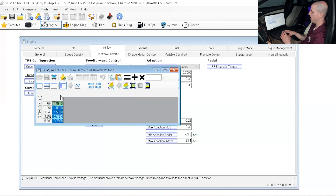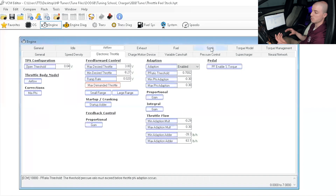What I like to do is go ahead and simply max that out. So we're going to put the number 3.8 in there, and that's going to say that as a driver, I can now add as much throttle as I want. Now there are multiple different ways we could get to this — this is just a mild way to do it. So we pop that in and now we move on over to our spark side.